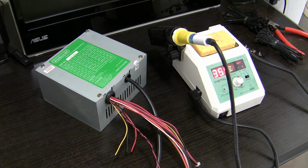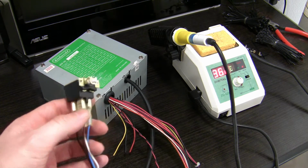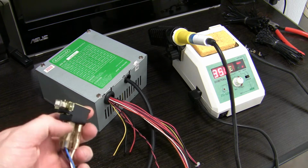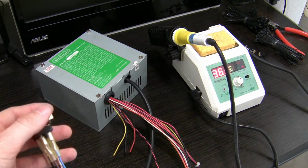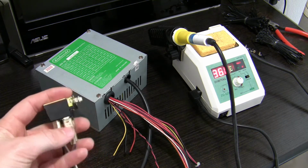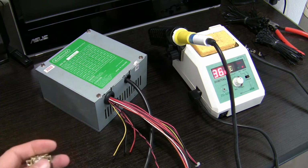I have been a stupid caveman guy, so yes, I did connect my power switch to my power supply, and yes, this is the correct sequence for this switch. There is a general rule, lighter ones go together, darker ones go together, but this of course depends on the switch, so better check with a multimeter. With the button pressed, the couples should have a direct connection, brown connected to black, and blue connected to white. This is how it goes.